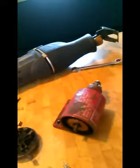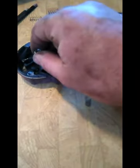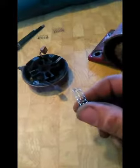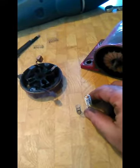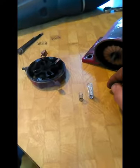The sawzall still runs great but the end that holds the blade on broke off — the end of the shaft, the metal part just broke off; it was one of those quick-detach types. That fits right down in there — I'm just going to have to get it pushed down in with the brush and everything, and I may have to trim it just a hair. Old sawzalls that have a brush cap like that will have a spring in there like this, captured between the end of the brush and a little brass plate with a copper wire going between them — I just cut the copper wire and took this out. Other places you can find springs like this: old skill saws, old drills, old jig saws — anything that basically has an aluminum case.